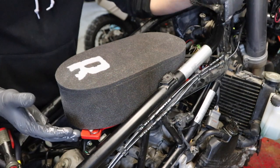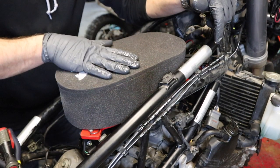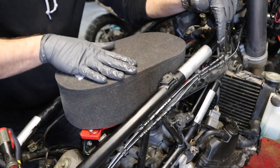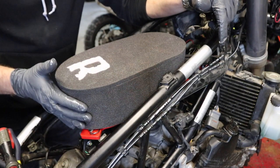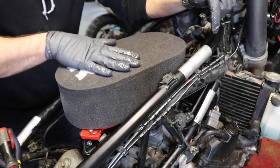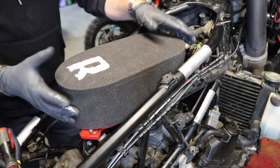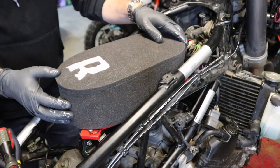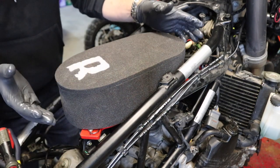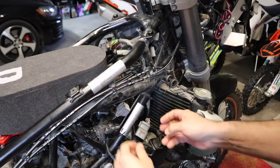Now we've got even extra filtration. What's also nice is if you keep a spare pre-filter — I've got a few spares — you can pop these off when they get dirty. Lots of times you'll find the inside filter is still perfectly clean as long as it's still got oil on it. You can just pop one off and pop a fresh one on without having to take the entire air box apart or wash it. Something I like to do, but I'll leave that up to you guys.